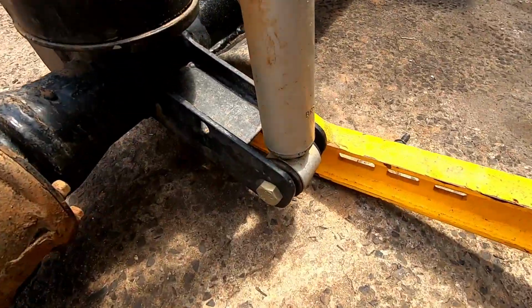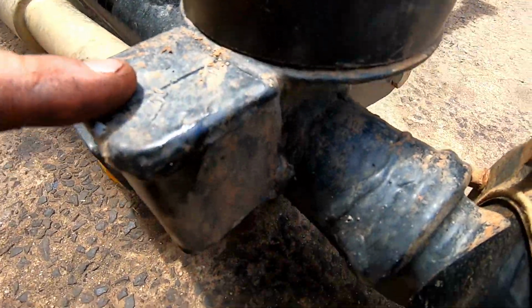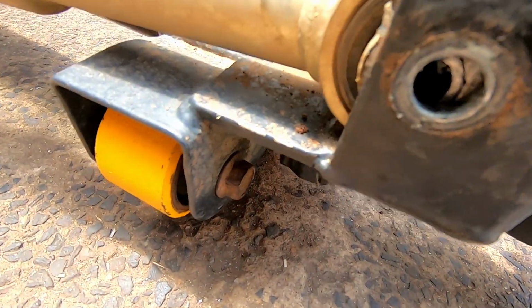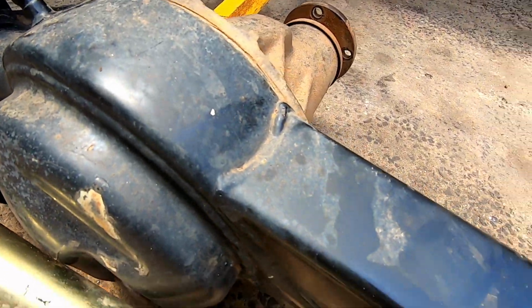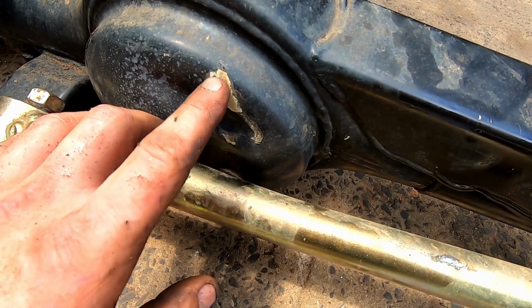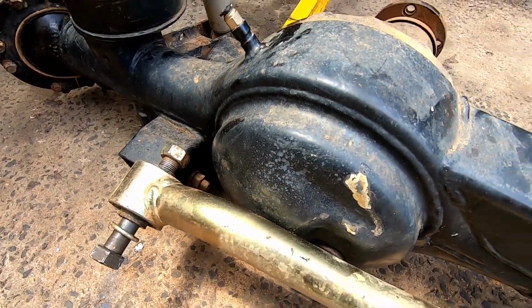You can see my shock mount's now a bit better. And this one I didn't show before. This bottom panhard mount's been modified and it ties right back into the coil mount there. There's the truss on the top. Brace, whatever you want to call it. That marks from the panhard rod smacking the diff because I didn't have my longer bump stops in, which they're in now, so it's all good.